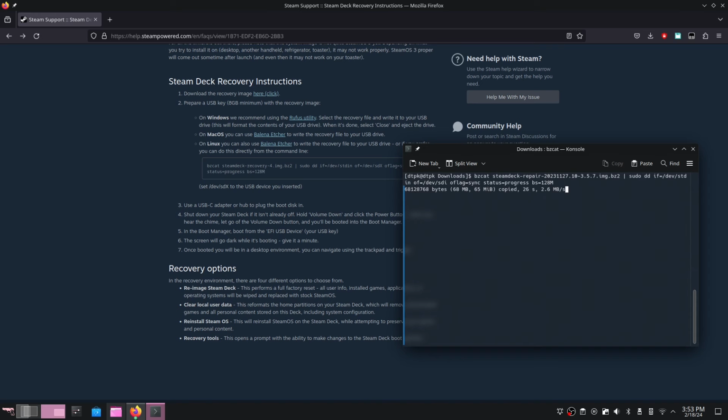And speaking of the USB drive, I believe I used a 16GB USB, I'll have it on screen if I'm wrong. There is one thing to note. Since it's like we're burning a DVD, but instead setting up a USB drive, this will completely format and erase our USB drive, so make sure to back up any files on it before you run the previous commands. But yeah, that's pretty much it.